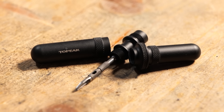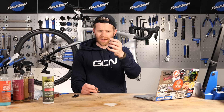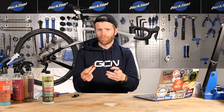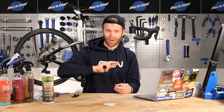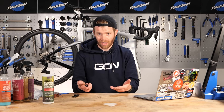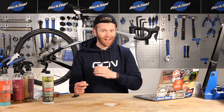You can inspect the hole to see if a plug might fix the issue. Plugs like these can be used to repair tubeless tires - use an insertion device such as a TubiMaster to force the plug inside the hole in the tire, then pull it out and the plug stays in there. These work much better with off-road mountain bike tires because the pressures are lower. On road bike tires, higher pressures mean plugs often get blown out when you inflate to a rideable pressure. More specialist plugs such as Dyna plugs are more effective as they can anchor inside the tire.